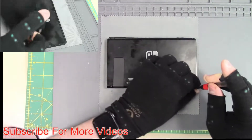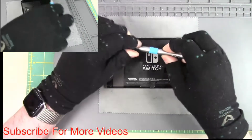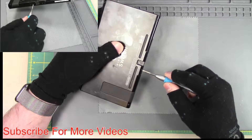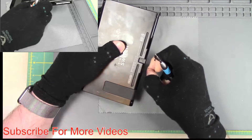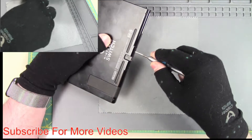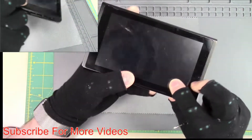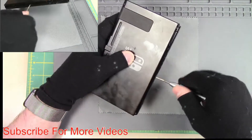The kit comes with this driver, a Phillips driver, some picks, and tweezers. I've got three non-magnetic screws to remove here. You do have to disassemble the console pretty thoroughly to get to the power flex cable. This one is also going to get a new digitizer, but that will be a separate video. And also a new back case.